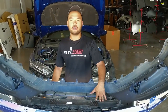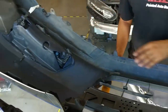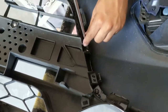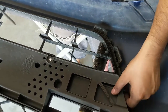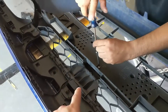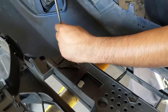Today we are transferring over all the bumper accessories from a bumper on a 2018 Honda Accord. This includes the grills — upper and lower — and the fog lights, fog light bezels, and all that stuff. We're starting with the bottom grill because the bottom grill sits on top of the big piece that goes across the whole bumper, with the bottom grill situated right on top of the middle one. So we're going to loosen all the screws and take the bottom one off first.